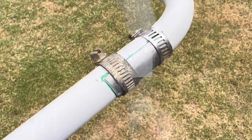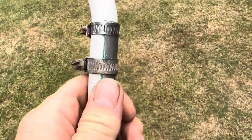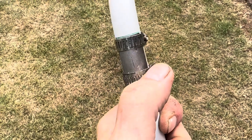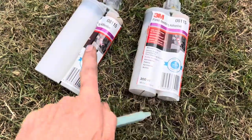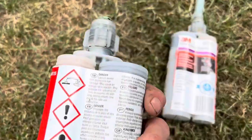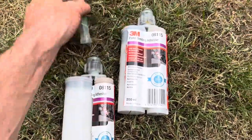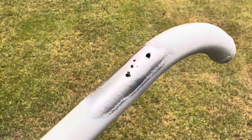Obviously if you had a welder you could just weld up those holes, but the thing about the panel bond is it'll give you a watertight weatherproof seal and will actually squeeze itself into those holes and stop the pipe rusting from the inside out in the future. This panel bond is expensive — you can pay £40 for a tube like this. Just before you're about to run out, keep it — the next time you've got a small job, use what's left to push out a fuller tube, and then use fresh panel bond to squeeze it out.